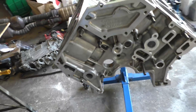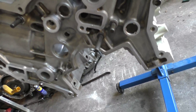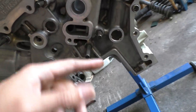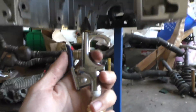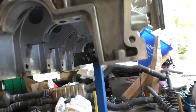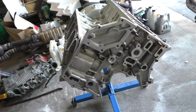You need to make sure all these oil passages are cleaned from inside. I already cleaned them once by putting gasoline inside to dissolve old oil and also cleaning with a long wire brush through all the passages. For now, since the galleries are already cleaned, I'm just blowing compressed air through all the oil galleries as a final step to get any dirt or debris out before I start putting everything back together. If any dirt gets in there it'll go into the bearings or hydraulic lifters and cause problems later on.